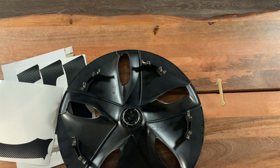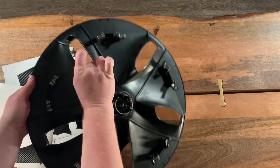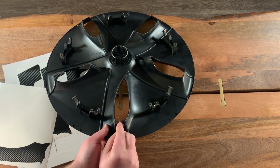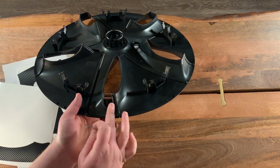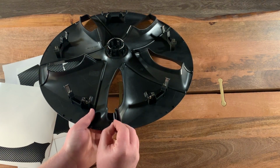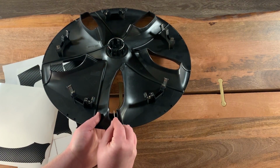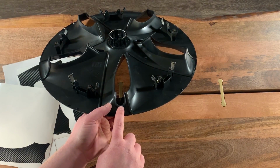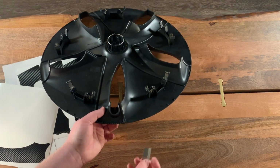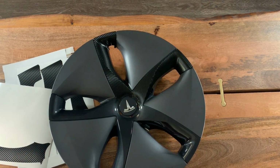Okay, so now this is the one use of the included razor blades, on this area. What you want to do is just slice into it, because as you see, it's not going to conform into this area. It needs to be cut, but we're not cutting out the circle. We're actually going to put a slice in it from the middle, coming right down into it. And we're not coming all the way down to this edge. We're going about 1/4 of an inch from this bottom edge. And now that the slice is there, we're going to heat up that material.